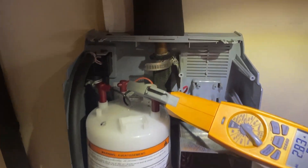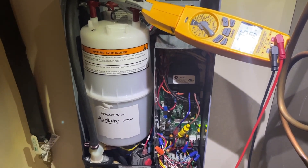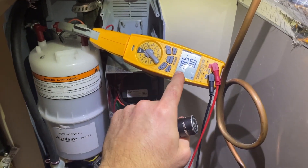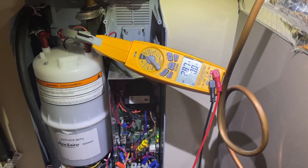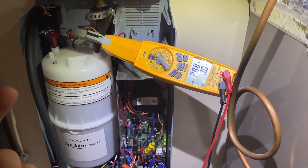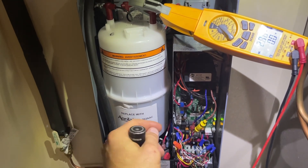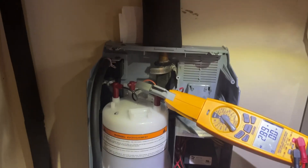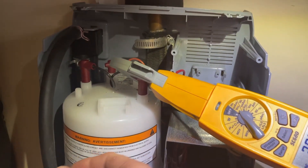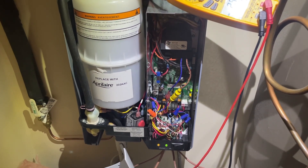I've got the hose off so I can see the steam output. This is only 120 volts, so it's going to take a while to heat up the water. But I'm getting amperage. Now what should the amperage be? Non-zero — it should be around this range. A lot of it depends on the TDS of the water. Sometimes you've got to add a bit of salt to bring that up and create more current, but in this case you don't really want to do that unless you have to.